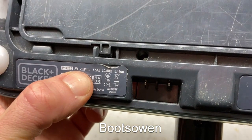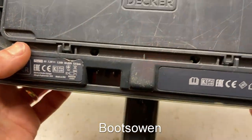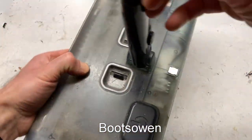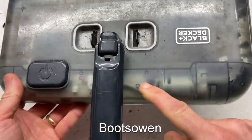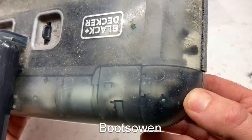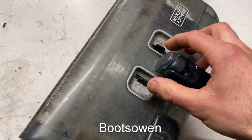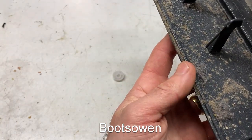7.2 volts, which presumably means it's got two 18650 batteries in it — we'll have a look in a second. It should have these brushes spinning all around the outside, but if I turn it on, it makes noise and nothing happens. You can look from the top and see maybe four cells, a board and a motor, but the motor certainly is doing something but it's not turning this brush, and I think it then runs a chain of brushes all around. It's quite dirty, and to clean it you just squeeze these guys on top and the trapdoor on the bottom falls open — and it's kind of moldy in there.